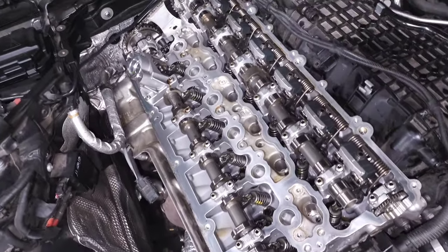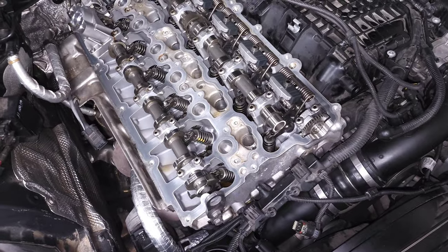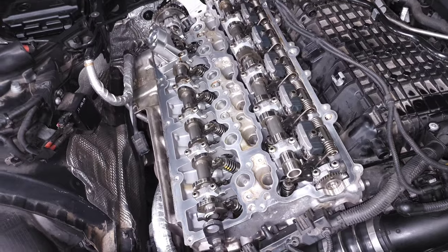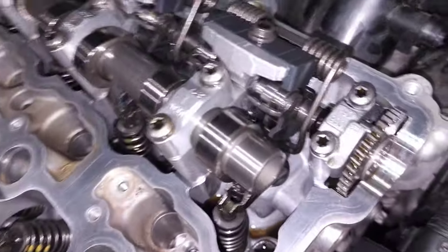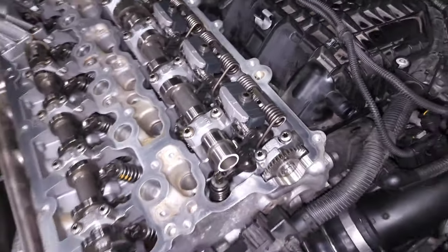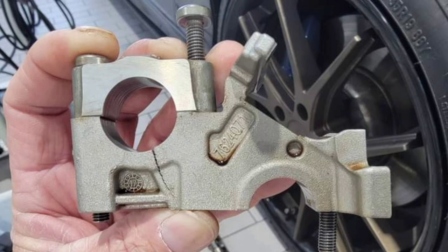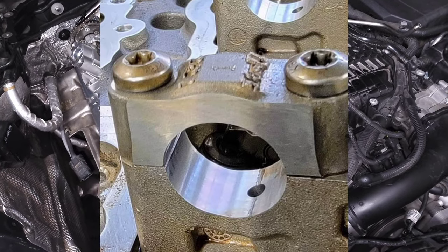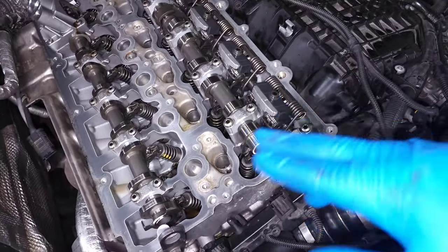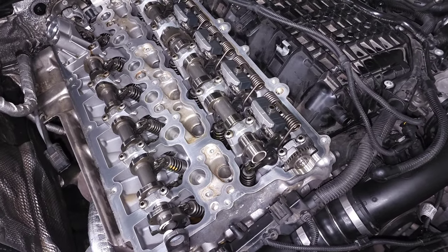This cam design seems overall very good and most B58s run very strong. What I've seen is usually one of two issues. The main one is that this cam, the way it's hanging off of this side of the cam bridge, seems to have a failure mode where the bridge holding it in place cracks. If that cracks, you're going to have difficulty managing your airflow on cylinder one. If this cam can't turn properly and actuate your valve, you won't get the right amount of airflow in cylinder one, causing misfires, rough idle, and things like that.